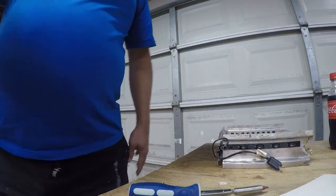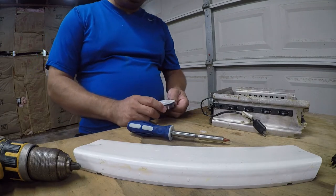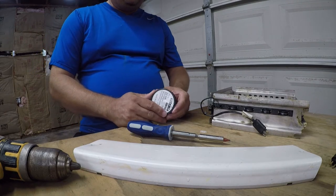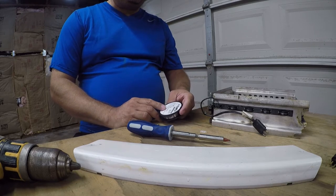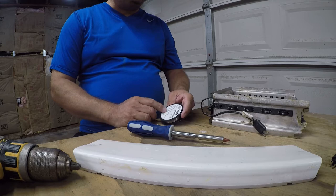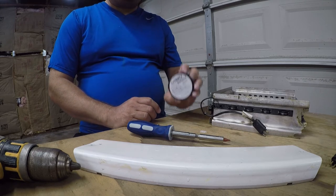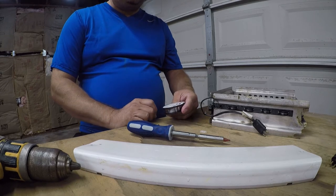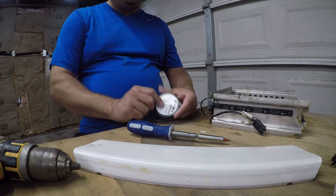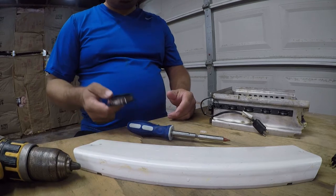Pair of wire cutters. I'll be right back. Okay, so in order to make the repair, you need some nichrome resistance wire. The thickness of it and the alloy determine its resistance. You're aiming for about 1 ohm per foot for this. And so this product, which I'll put a link to in the description, is a 22 gauge nichrome 60, and it should do what we're looking for. I got this on Amazon for like 10 bucks with free shipping.